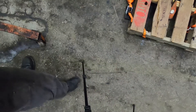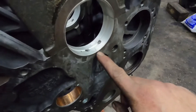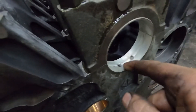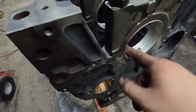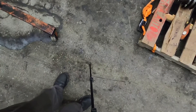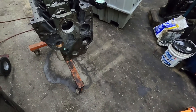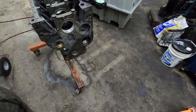It's hard to do this while watching the camera — kind of a three-eyed, four-hand person job. You measure from here to here, and then here to here, just to make sure everything's round. You will get little tiny marks in the bearing from doing it, but there's nothing you can do about that — the marks you can't feel, it literally just shines the coating on the bearing so it doesn't hurt anything. I've taken a few of my motors apart that have a lot of kilometers on them or are high horsepower stuff, and those marks will still be in there — so that tells you something. You're not damaging anything.